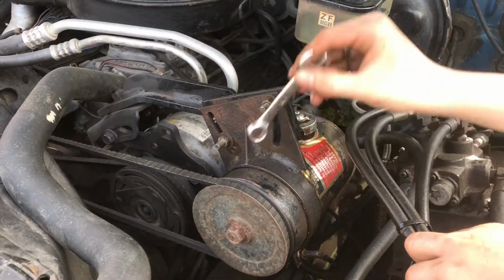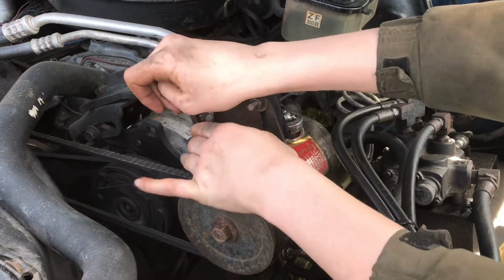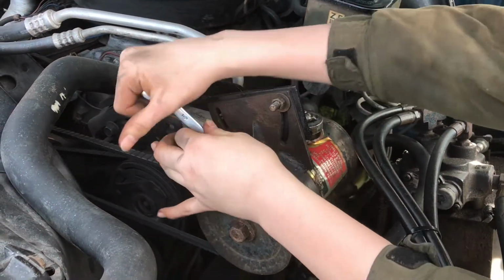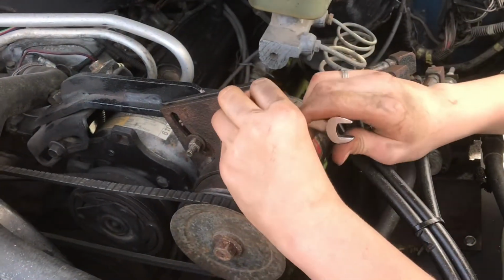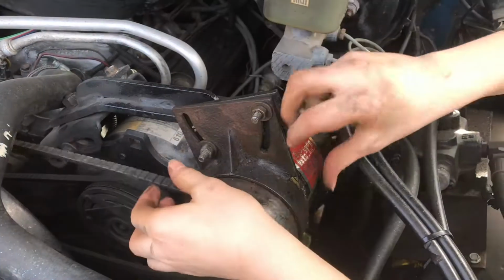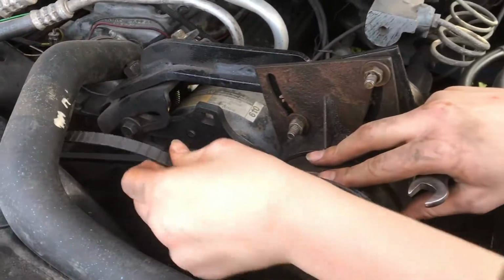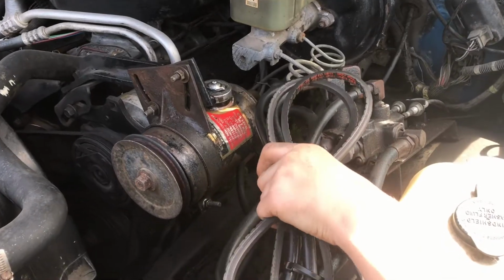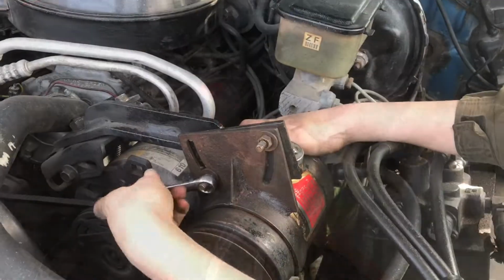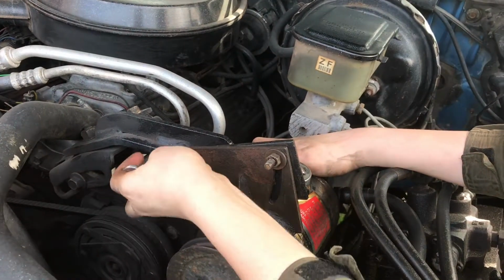We're going to be driving with this one, and we'll want to make it tighter. We don't want this pump running all through the summer whenever the car is on, so just loosen up these two bolts, and that'll loosen the belt so you can push it and pull it off. Make sure you don't lose the belt, and we're going to just zip tie it onto these lines right here. And make sure to tighten up the pump so it won't come off whenever you're driving.